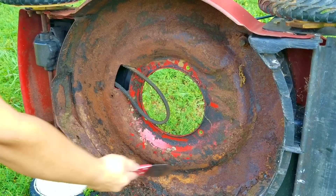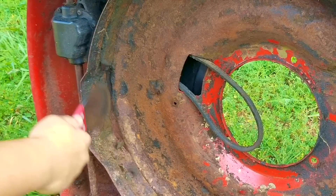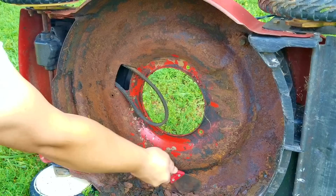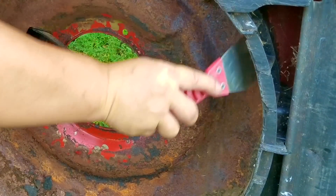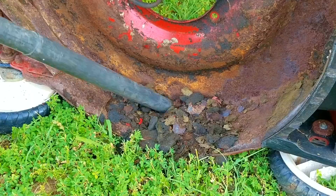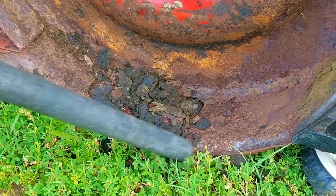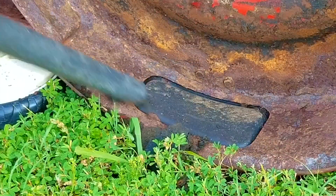This is where we have to leave this project until the gasket maker sets up and after I get the deck washed off. Remember I checked that the engine worked before doing this sort of repair — this would also be a great time to replace the engine if you think the original one might be broken or beyond repair. We got the engine back together and ready to be re-torqued, and after cleaning the mowing deck we should be ready to put it back on. The only issue is that we haven't serviced the carb yet, so we'll have to do that before we try to start it. Another reason this engine could have been leaking oil would have been a crack in the block — unfortunately there really isn't a good fix for that, so replacing the engine would have been the best option.